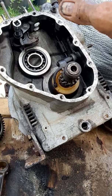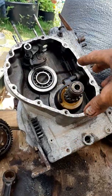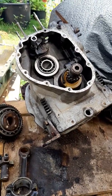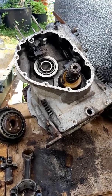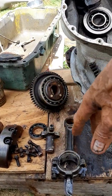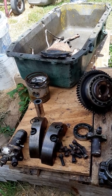I'm going to clean up all the parts and do some painting. I'll put a frame together and I do have a fuel tank that can work on it — I had an extra tank from my other engines, since I have three more of these engines. It's basically a lot of cleaning and a minor amount of parts replacement. Maybe piston rings — I haven't checked the gap yet — but I have some I can use if needed. The piston is in good shape, and the rings were a bit seized at first but I got them freed up. All in all, everything looks good.